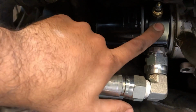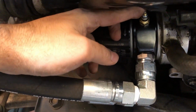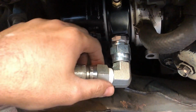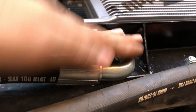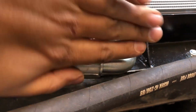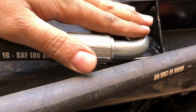So we've got our sandwich adapter over here with our temp sensor. I still need to wire this up. Filters on, it's all buttoned up. We've got swivel 90s over here because of the way these joints are made. They're crimped on, so orientation-wise, in this direction yes, but in this direction I can't change. So I needed to then provide them with offsets.